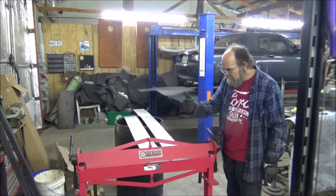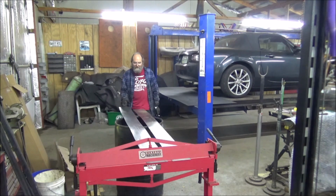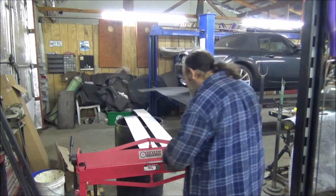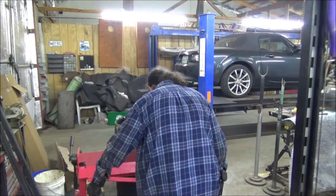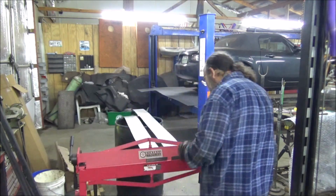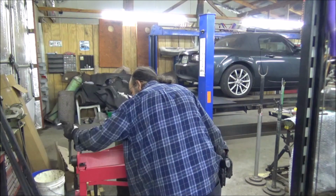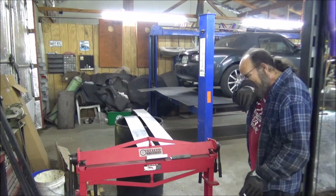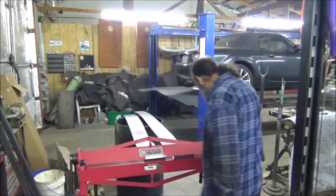And like I say, it's 1 inch. We've got to bend it. Pay attention when you're doing this, or you'll bend 2 lefts or 2 rights. You see I have these sitting in here the opposite ways. I'm just getting 2 bends with 1 shot. I can even bend this so close down here, and they're 90s. Yeah, that looks good there. Now what I'll do, I'll flip it over the other way, and we'll get the other ends bent the opposite direction. There we go. Got their 90s taken care of.